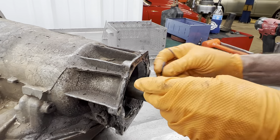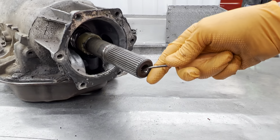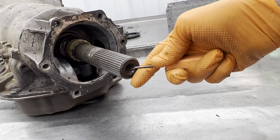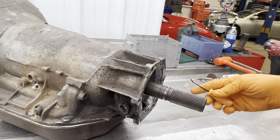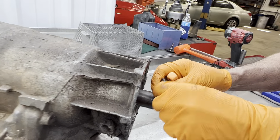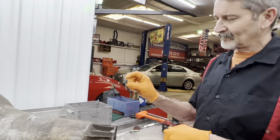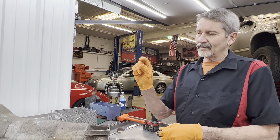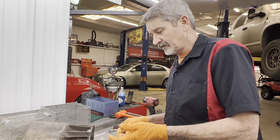They make a special yoke — they do make a two-wheel drive sliding yoke that doesn't bolt on, you can put it in any car that way. The yoke will still seal on the seal. At the end of the yoke on the inside, it's chamfered about that far where the seal physically works back and forth in that area right in front of the splines.